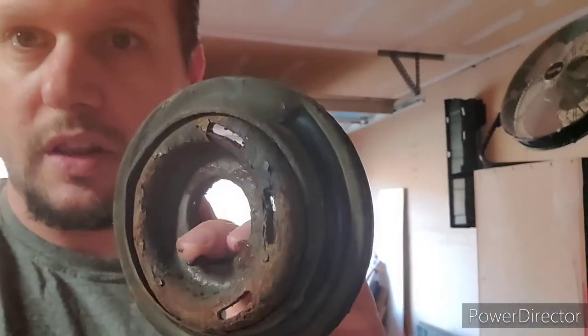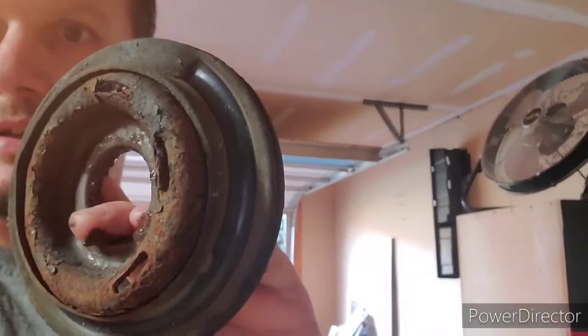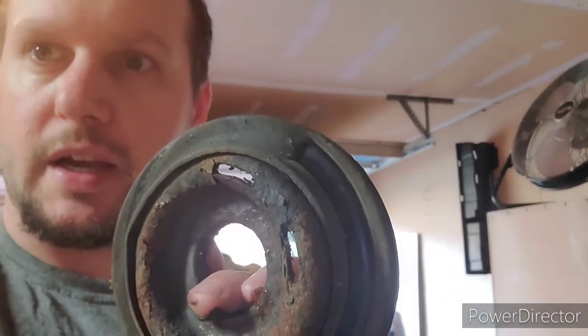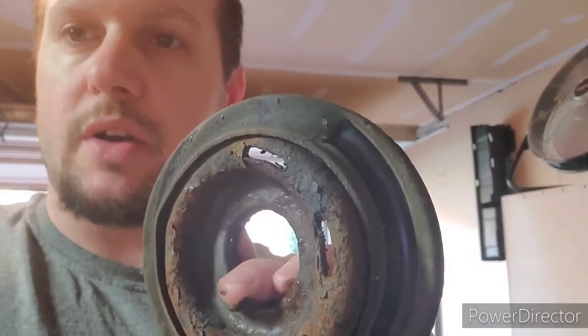And once you get the thing off, see what I do with it here. You have this here. You'll see where it came off. You know, the glare of the light there. You see the imprint right there from the spring. You can see it. I'll put a little highlight on there. Right there, that is where the top of the spring has to sit. You have to sit that in there right, because if you don't, it'll move around or it won't sit right. It'll eventually probably seat down in there, but that's not always the case.